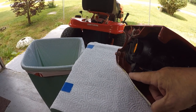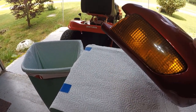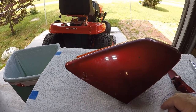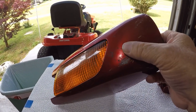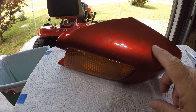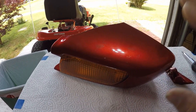Then I'll get my plastic welder and put some new stuff in there, rough up both sides real good, and put some metal screen on it — that'll adhere it real good. They got stuff all over the top, fingermarks from the glue down here, what a mess. But when I get done with it it'll look new. There's a crack across it that'll be fixed, and I'll have to sand the whole thing. I got some auto paint — one can looks a little lighter, one a little darker. I'll paint it with the light one first, hold it next to the bike, and if it needs darker I can go over it real light. I think I can get it really close — if it doesn't match perfect, I'm not worried about it.